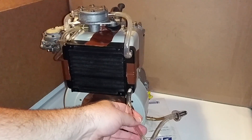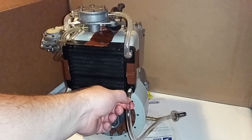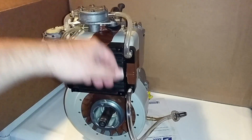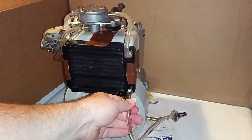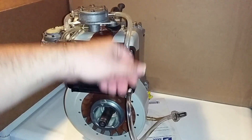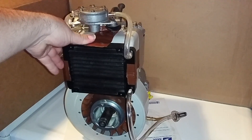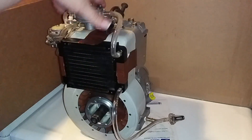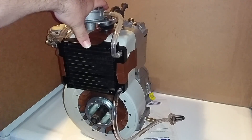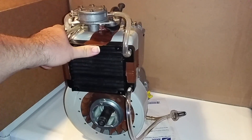I did bring the oil up to this point and the oil does drain back, so I'd like to figure out a way to put a check valve into the system to keep the oil from draining back into the crankcase, because that could cause oil leaks out of the fill plugs. Hopefully I'll get this thing tested soon.